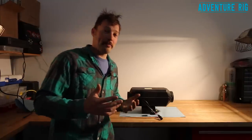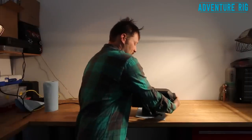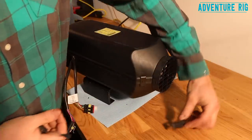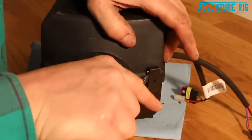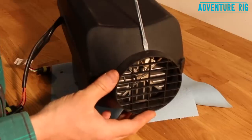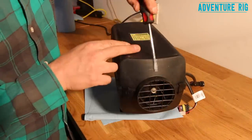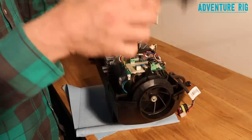Hopefully this doesn't happen to you, and if it already has, we're going to dig into this one, take it all apart, figure out how it comes apart and goes back together, and get it all cleaned up. Getting into pulling it apart — on the exterior of the heater you have these four plastic clips and they just slide off. I'm using a flathead screwdriver and just prying those off to the side. With those four off, you now have your intake and your exhaust on the heater here. It just pops right off on the top, and I'm going to do it to this side also — just putting the screwdriver under there and popping it right off.